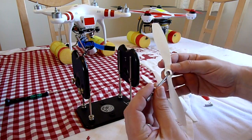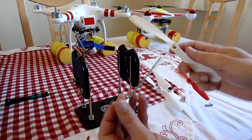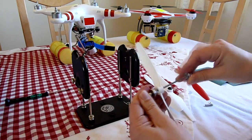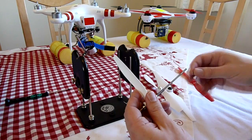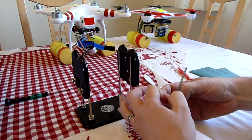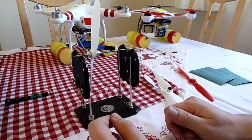On the Phantom propeller, one side has got the flats on the top and the other side hasn't, so I've got the cone side into the side without, and the flat side goes on the other side — that way the propeller is pinched tightly. Then the spring, then the washer, then the little piece of fuel tube. Just pinch that up and mount it on the balancer and let it hang.